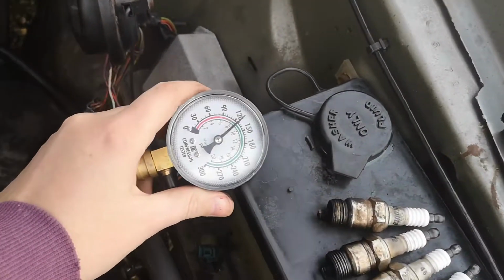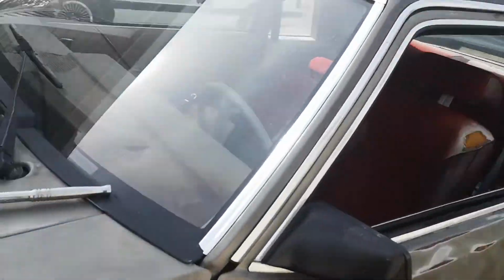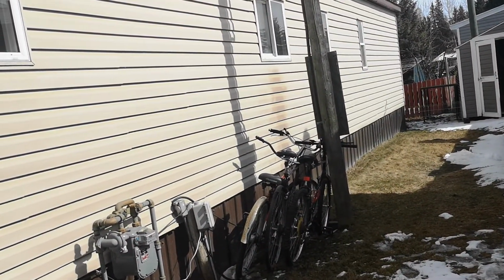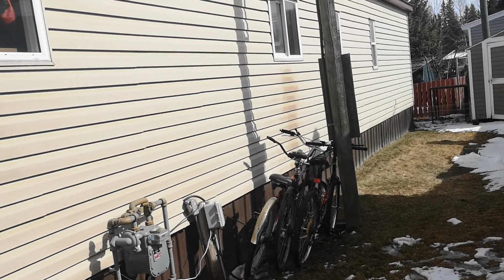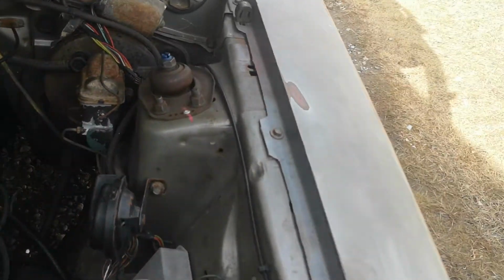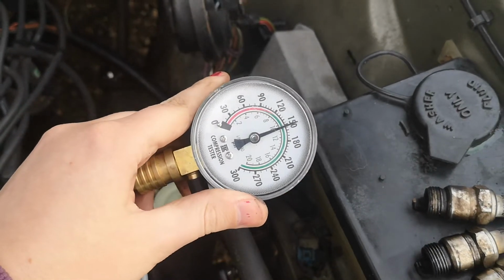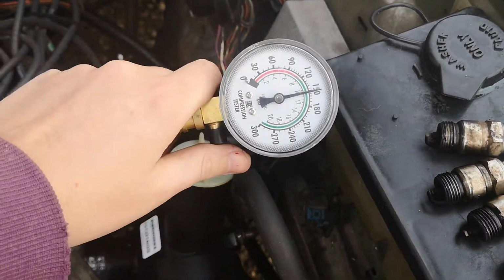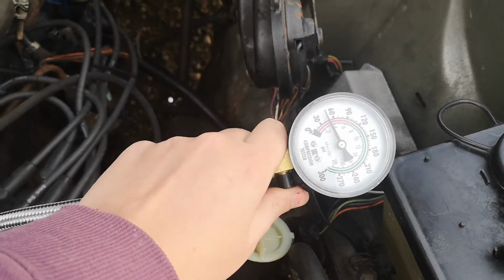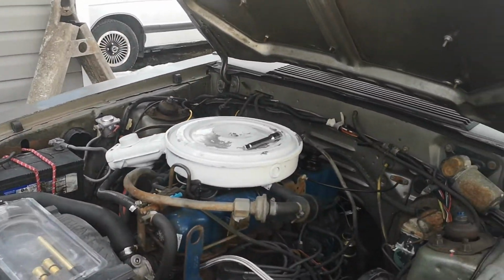And that's actually, hang on. Let me just double check on that, if that's correct or not. Might need a little more than that. There we go, that's better. So sometimes you'll want to do it 5, but other times, if it looks a little low, just try it again. And so as you can see, that's 150 PSI. That is more than good. Now, before you take this off the cylinder, press the button in to release the air. Then you just unthread it and do the rest.